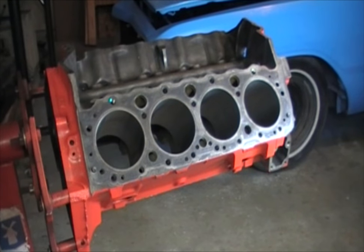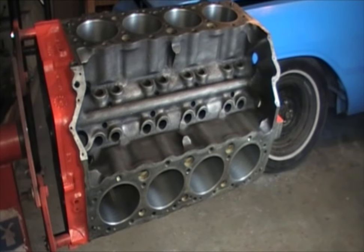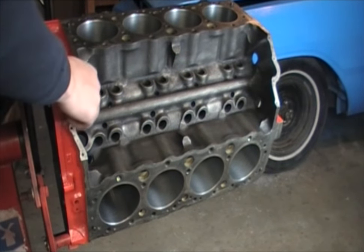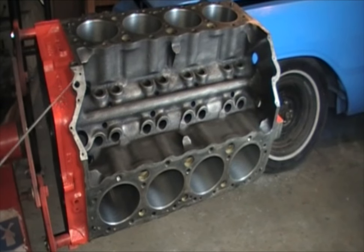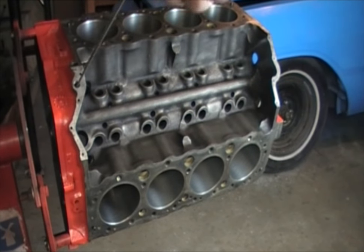The first thing I'm going to do is go over the engine and show you where all the freeze plugs are that you need to remove before you clean the block or take it to a shop. Under here, this is an oil pressure sensor — mechanical. There's going to be a cap on there. You're going to unscrew that and take a rod — I used an old antenna — and slide it in there until it bottoms out. Then take a hammer and tap it down to knock out your hidden freeze plugs. That's after you remove all the main caps.